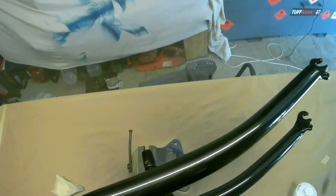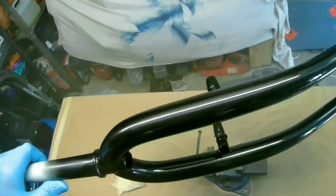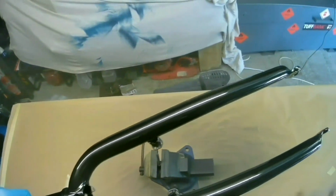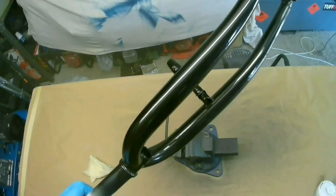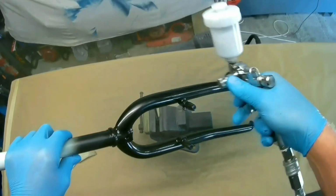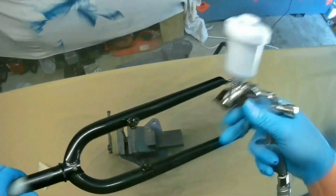When you're spraying it on now, you're spraying it on thick enough that each droplet will flow into the other, so it gives you a flat, or as flat as possible, gloss finish. And that's the whole idea. So it's had one light coat, and now we're having a further full coat. I can't quite remember, I'm narrating this a couple of days afterwards, but I think I put another full coat on in a minute. That flows out nicely, simply because it's in the gun, and it finishes them off nicely.